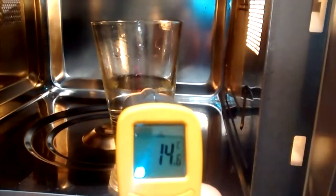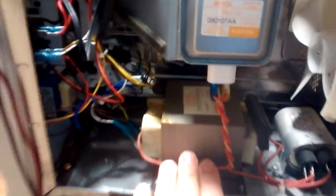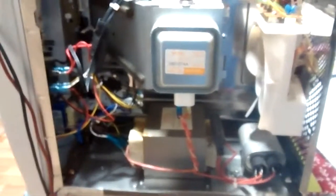As we can see, the water is still at the same temperature. First things first — you're going to switch off the appliance from the mains. The appliance is now switched off, and since we know the transformer is powered because our power meter told us we have an inductive load, we know that we have a problem on the secondary.